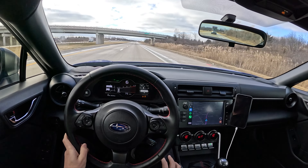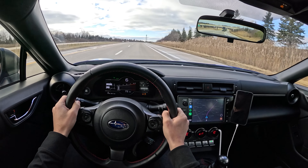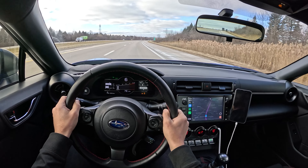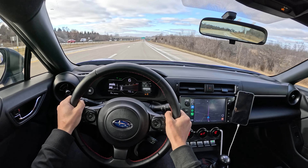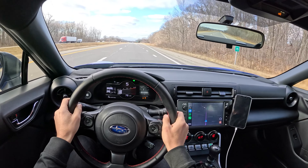These Winter Peak F-Ice 1 tires — I love the name — they're so stable at high speeds. That's one thing with winter tires, they can get a little bit squishy, especially in the sizing I have: 205/60R16s. Those taller sidewalls can get a little bit sketchy. I had a set of Michelin X-Ice snows on here last — the sidewalls were a lot squishier than these F-Ice 1s. As a result these are pretty fun to drive on. They break away progressively, give you a little bit of steering feel, no tread vibrations. They broke in pretty quickly, no issues right off the bat with balancing or noise. I have no idea how they handle in the snow because it has been so warm and so dry, but they do very well in the wet, and that's important.